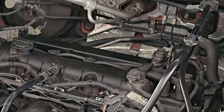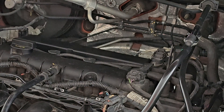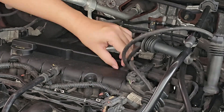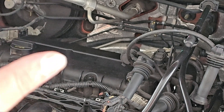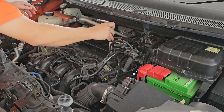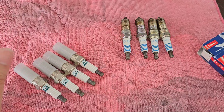The test drive has been done — I'll show you the figures shortly. Let's talk about how we change the spark plugs. There are four coils and four plugs that you need to take out, located here: one, two, three, four. What we'll do is remove the cover first, then once you remove all four, you basically just wiggle them out.